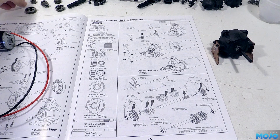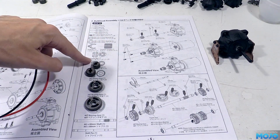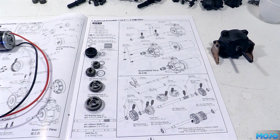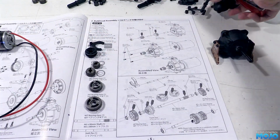with its gears. First, we're going to need some gears, the 20, 26, 34 and 40 tooth ones. There's the transfer nut, or dog clutch. It's plastic, but that's probably a good thing considering it's engaging with the metal gears. It should keep the metal on metal wear to a minimum. To go with the clutch, we need the shift fork. Now 3Racing call it a shift bar, which is a bit odd.